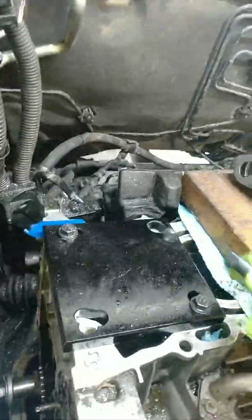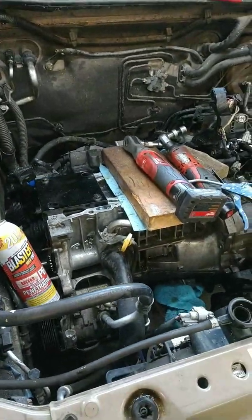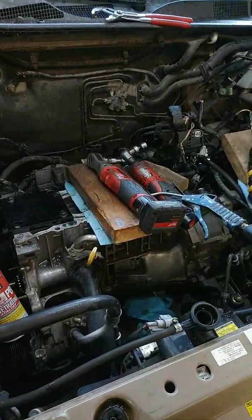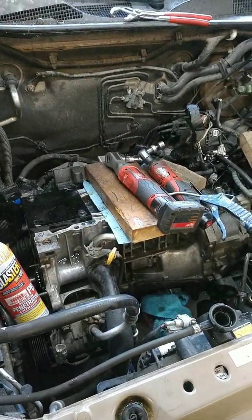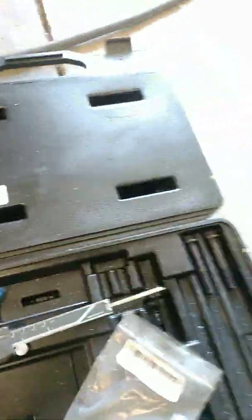Pull the plate back off and clean up your tools for the next hole. It's a little time-consuming, especially if you're doing all of them — which I would definitely advise: do all 10 cylinder head bolt holes on these blocks. So that's how you do the thread bolt repair with the Time-Sert kit. Thanks guys, have a good one.